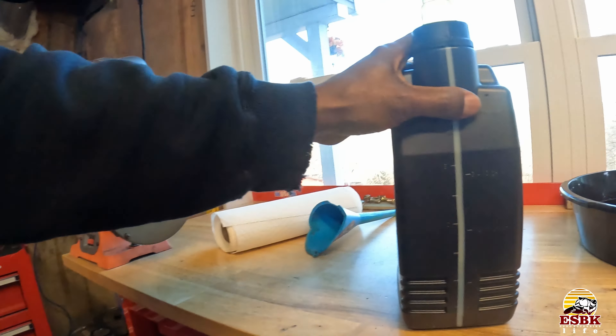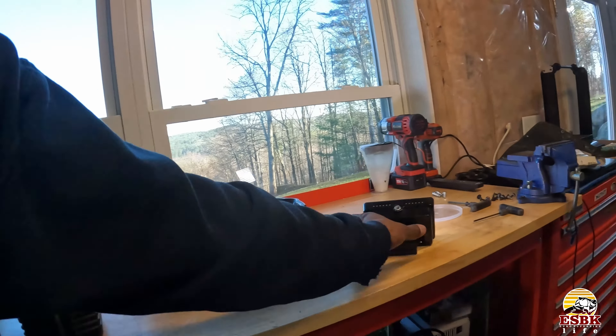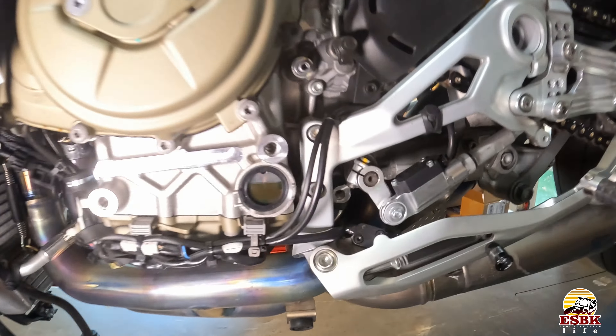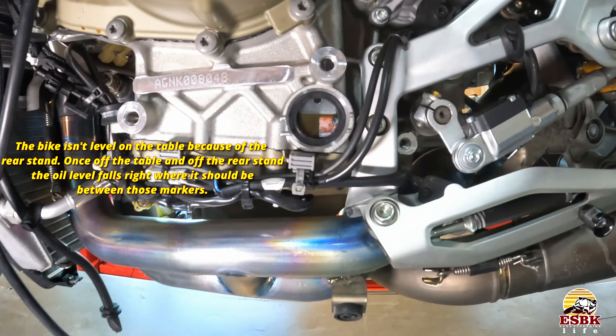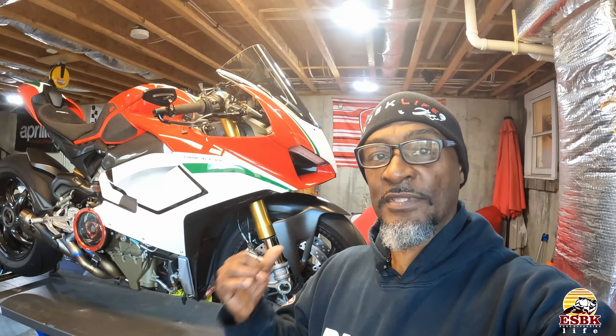We are finished filling oil. We're back on the lift — I had to go out and back a couple of times just to top it off. We are right at one liter, maybe a tad bit below, and we are right at our top marker. We are within specs. The only thing left to do now is put the lower fairings back on and wrap it up. This is also a good time to take a look at anything under there, do some cleanup, and clean the lower fairings since they're off anyway. I think we can wrap up for this video guys — hopefully you found this informative. I am Derek, this is Euro Superbike Life. Like, comment, subscribe — or smash it if you're into that kind of thing. Until next time guys, happy holidays.